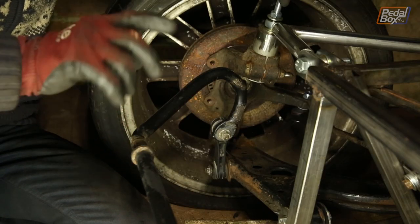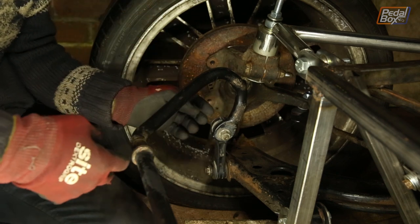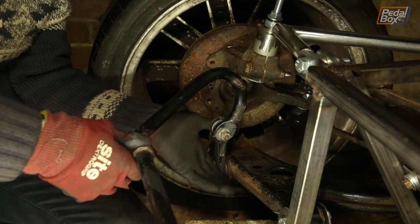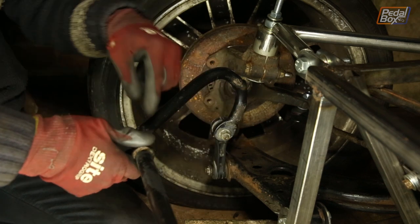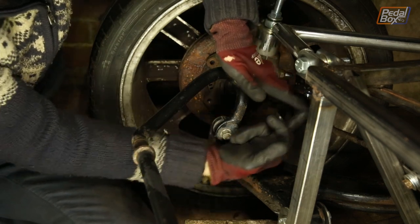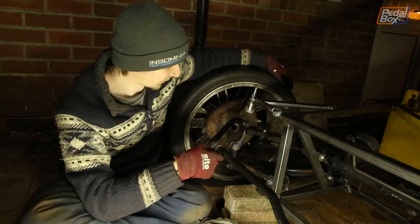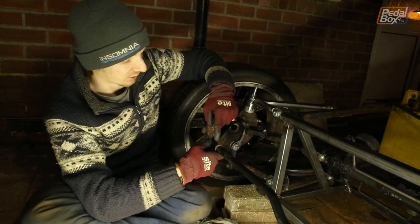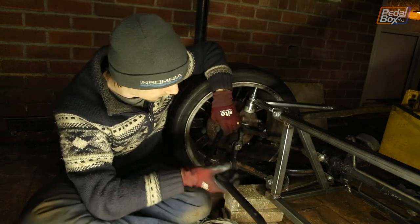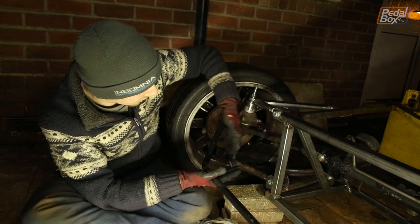While we've got the anti-roll bar mounted out front, we can demonstrate the problem with the geometry having it attached above the steering rack. The basic issue is that the drop link pivot here is mounted a long way below the body pivot here. So as the suspension arm compresses, this actually needs to move back as it rotates around this pivot, meaning the drop link needs to bend that way to meet this joint moving up. The drop link isn't designed to do that — it's a hard piece of plastic, so that's not great for it. What you really want with your anti-roll bar linkages is for your pivot point on the body and the pivot point on the drop link to be level with each other, or as close as you can get. So if we lower this down a bit, as the suspension compresses, that point is only going to move up on the radius of the arm rather than trying to move up and in — so that's really friendly.